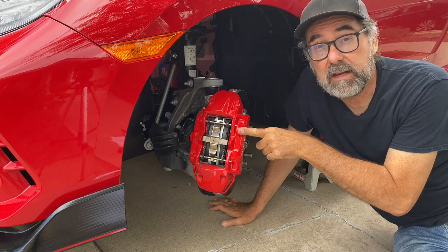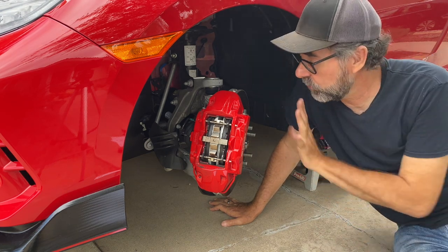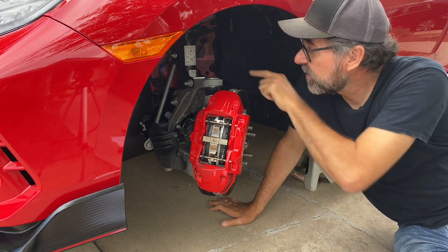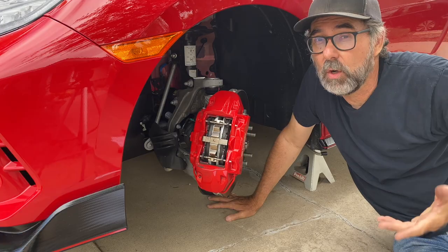The brake and hub turned, but the strut didn't — and that's not how strut suspensions normally work. Usually the strut turns right along with this. So what we're seeing is the second axis, which is evidenced by this upper ball joint here and all the structure that's behind. So why'd they do it?